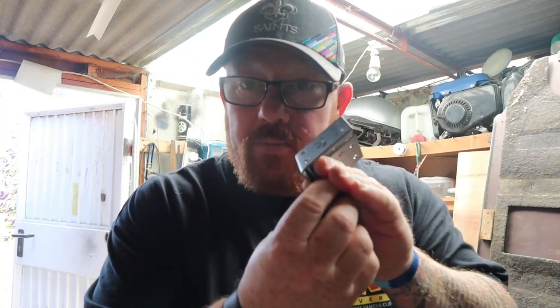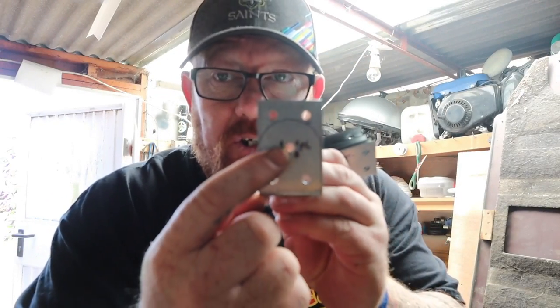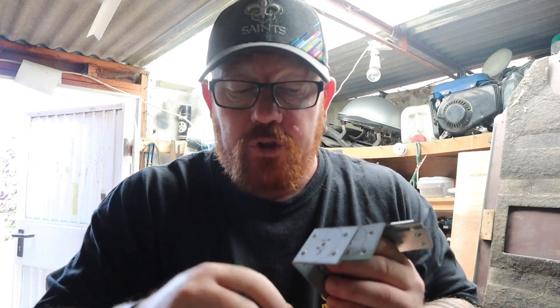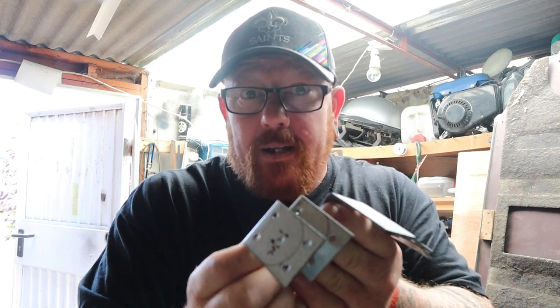Now that we've got the solar on the roof, we need to make some brackets so that when the solar's down, we can use these M8 bolts with a handle on, to go through and attach inside the actual solar panel to keep them safe. What I've done is I've taken a shot glass and marked out a little archway, and I've transferred that to all four brackets. We're going to put them in the vise - I don't think we can cut them with the jigsaw and my grinder is not the best - so we're just going to nip the tops off with the angle grinder, then get on the bench grinder and round them off so they're not sharp and pointy, because it's kind of dangerous. Then we'll spray paint them black and get them on the roof. First of all we need to drill bigger holes because those little bolts aren't going to take these.